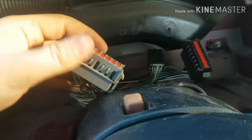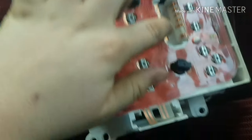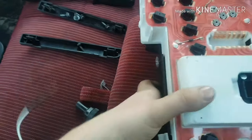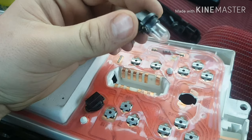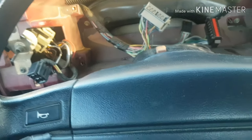Actually there's not two, there's three. There's two bigger ones — this guy and this guy — and there's this little tiny one that goes right in the middle here. The gray one goes into this one and the black one goes into that one. Now if you were just changing a bulb, at this point you'd grab some pliers and just pull these out, switch out your bulb, put it back in, and then put the gauge cluster back in the vehicle.